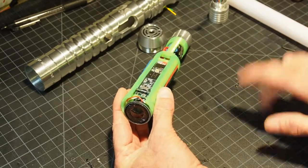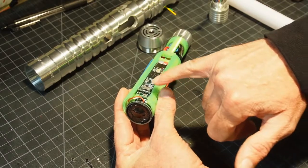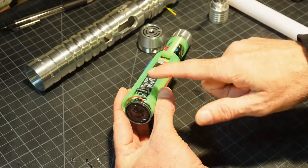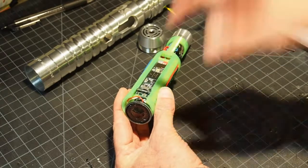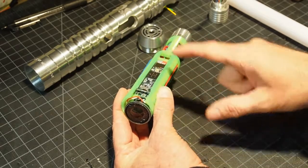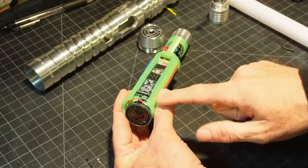The most important thing, and I cannot emphasize this enough, is this does not take a standard USB. It needs a USB that is data only. It is absolutely critical to not plug in a USB cable that has a power line, because that will short the 5 volt of the USB to the 3 volt of the battery.